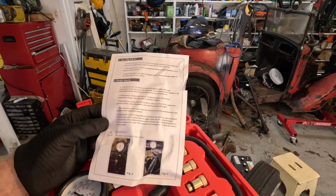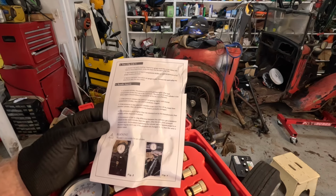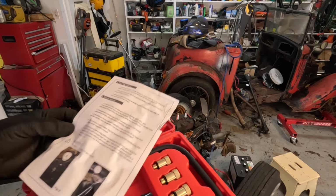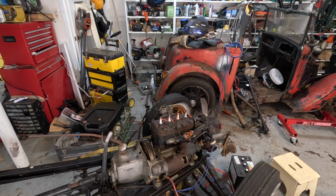Okay, we can do this. After this test, if the pressure increased much, the problem is probably that the cylinder was not seated properly or the piston ring was worn out. If the pressure not changed much, then the valve is probably leaking, I guess. Probably translated from another language. But that's okay. So let's get moving.